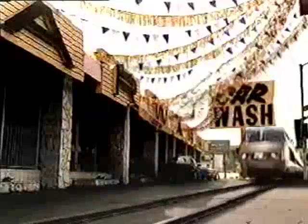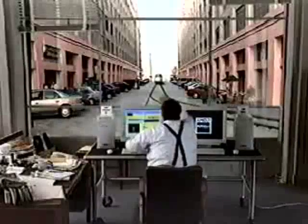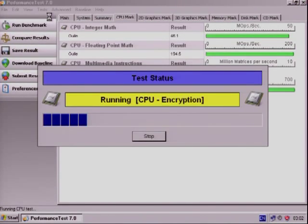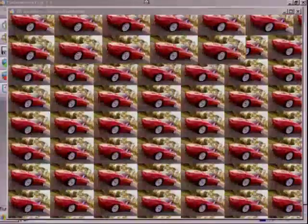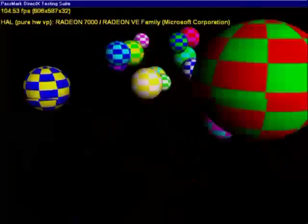At the time this machine was around, there was a lot of hype around the AMD Athlon — nothing could touch it. That begs the question that's been around for over a decade: can a Pentium 3 beat an Athlon? It's time to settle this once and for all. All the other systems completed their benchmarks, so all I have to do is test the Pentium 3 again. Unfortunately Windows XP won't boot with the system in this configuration, so I can't run it at full speed — this is probably due to timing issues with the RAM and AGP bus, which is likely why the chipset never officially went this fast. I can get 840MHz out of it and we'll see how it fares.